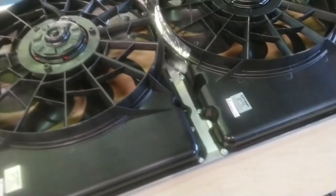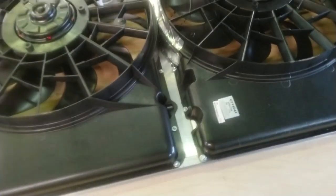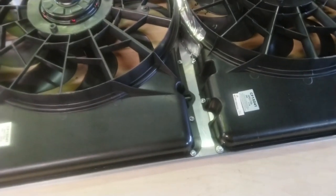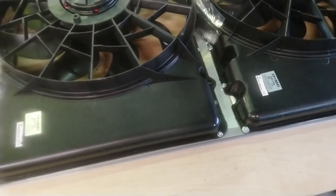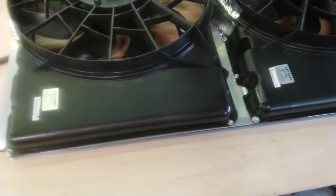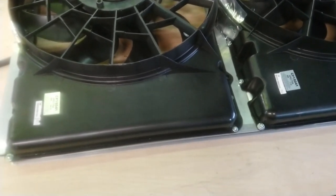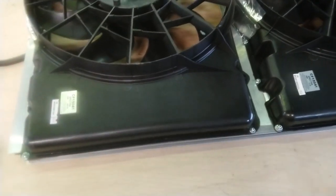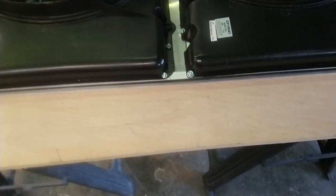It's got every option you could think of. Rear air, all that stuff. When you turned everything on, even without anything added onto the truck, when I was sitting in traffic, just idling, the alternator could not keep up. When I had high beams on, both AC units full blast, stepping on the brake lights, everything, I sat there and I could watch my voltmeter drop.